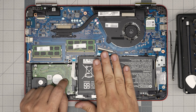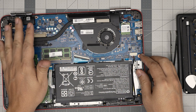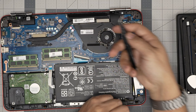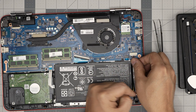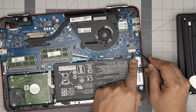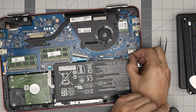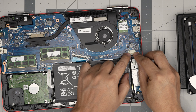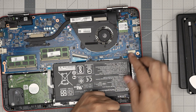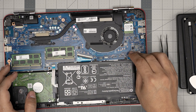To remove the RAM, you do not need to disconnect the battery — it's absolutely not necessary. You can just remove the RAM with no problem; you can touch the motherboard, it's safe. But if you want to be cautious — for example if you're worried about dropping a metallic object onto the board and causing a short — then you can disconnect the battery. Don't pull on the cables; put your fingers on the sides of the connector jack, pull straight back, and it will come disconnected. To reconnect, put it straight in front of the jack and pinch it in straight. I hear so many people bend the pins trying to put it in and end up creating a short — goodbye motherboard. So just don't drop anything metallic on the board and you'll be fine.